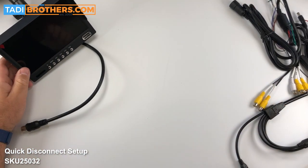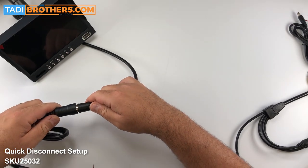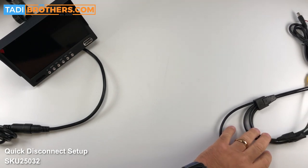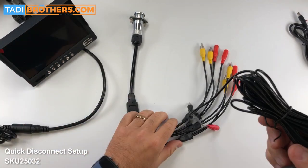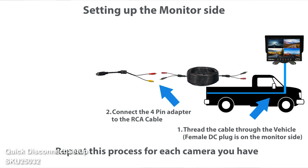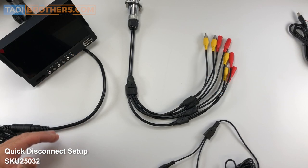So back to what we're talking about today. Let me first plug in the monitor. We're using a split screen monitor — we're going to take the harness, match up the two arrows that you see right here, put it together, and when you hear the click, you're there. Now let me start putting the parts together. The first part I'm going to address is the monitor side. You're going to start the process of setting up the system on the truck side from the monitor and go back to the end of the truck. The reason you want to do that is so the extra cable will be on the monitor side — you can spool it up, hide it under your dash, and it will give you a cleaner installation. You also want the spool to basically be where the power is coming from.